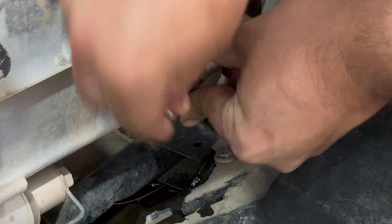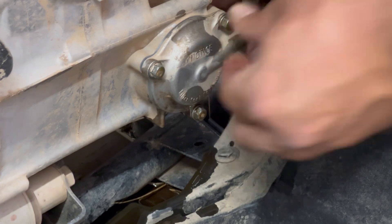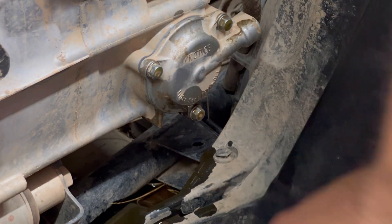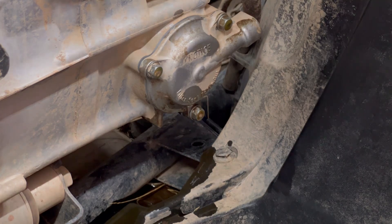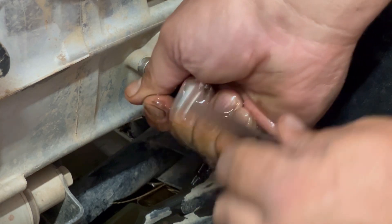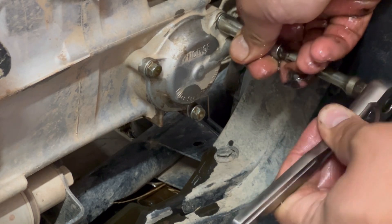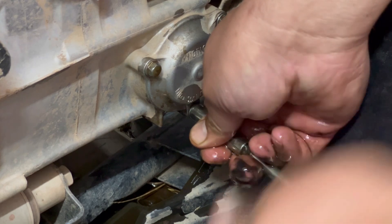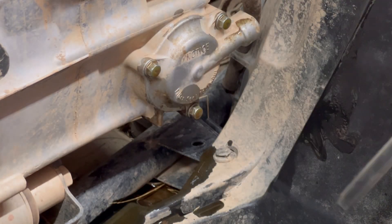Make sure your O-ring pops in there too. And as I said, do not use power tools for this — remember, this is aluminum and these are tiny bolts; they will break. Everything's an O-ring seal, so it doesn't have to be overly tight. And like that, we're done with the filter.